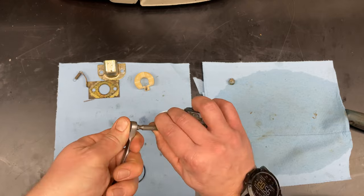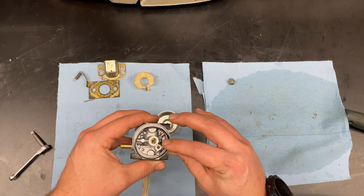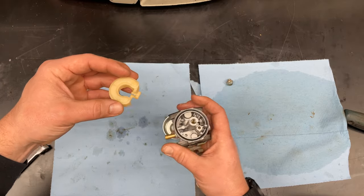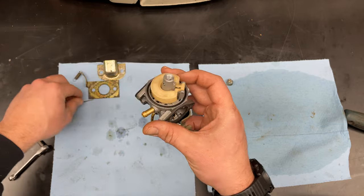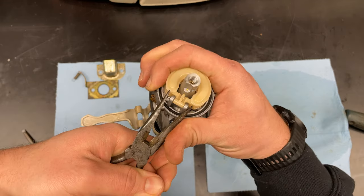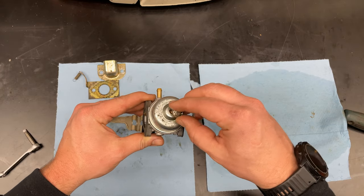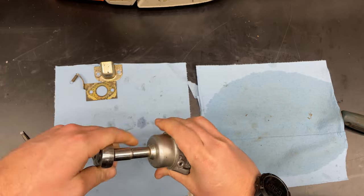We are really not tightening this all that much. Put the gasket on for the fuel bowl. Test fit it in there and make sure it's all seated with the bowl — looks good to me. Now the float needle in the float — make sure everything seats in there nicely. Pivot. Just make sure everything's free and smooth and it moves up and down with gravity. Now the bowl can go back on. Make sure the crush washer is on there or else it's going to leak. That's just going to be a 10 mil — we're not overly tightening.